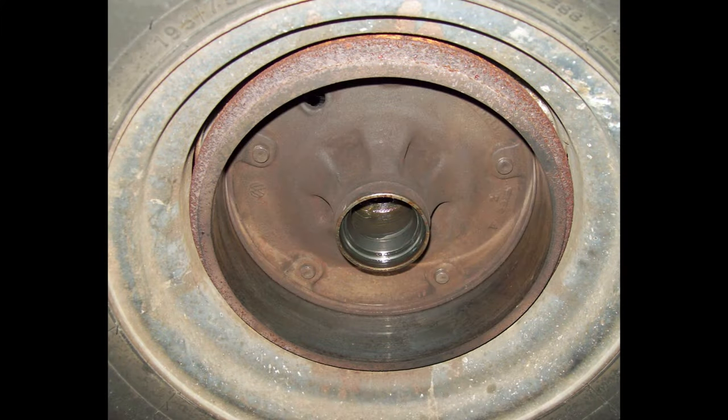These drums were in good shape — they weren't scored or ridged. You can see here I've removed the bearings. Clean the hole in your hub out where the bearings go, clean it out real good. On some vehicles you can knock these bearings out from the front using a wooden stick or a hammer handle — that won't damage the bearings and usually won't damage the seal. But not so in this case; it needed new seals anyway.